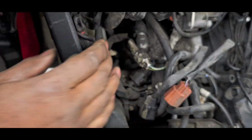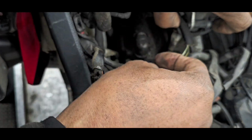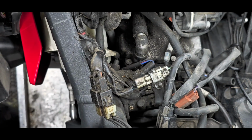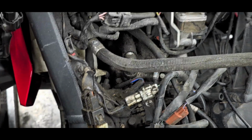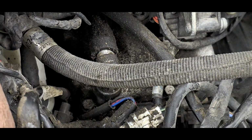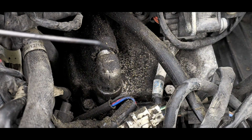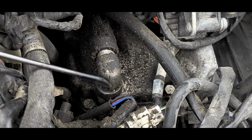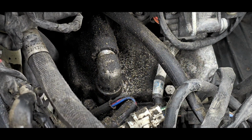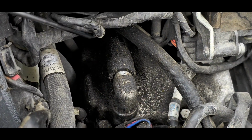And just wanted to point out here in this video that it appears your bike has got a pretty nice oil leak. You can kind of tell. Let me just tilt this up a little bit more and we'll zoom in. Oh yeah, see, look right there. So, sorry, my language. So this is a crankcase breather pipe. So oil fumes come out of this pipe and get fed into this rubber hose. And as you can probably tell, that rubber hose is missing what? You guessed it, a clamp.